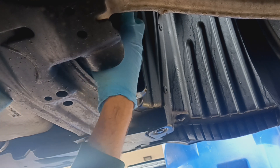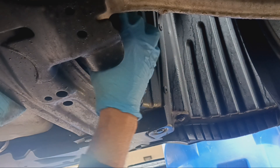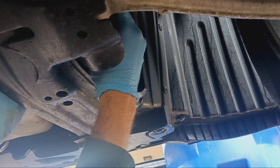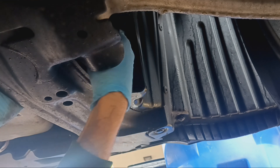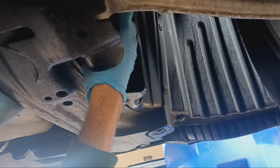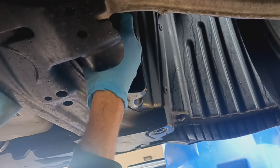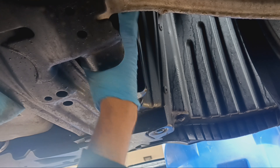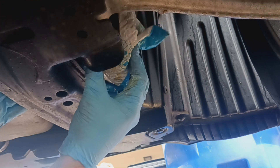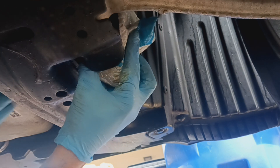The cup method is 100% easier because the cup spins with the filter all together and you don't run the risk of getting a splash. But with the bag you can get a little deeper, and it's a little softer so you can wrap it around the filter. This is still spitting out a lot of oil and it's not falling on the car chassis — it's all being caught by the bag.